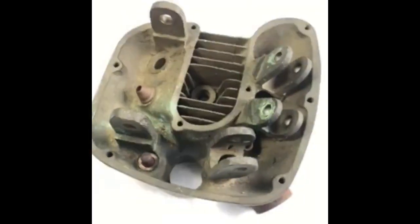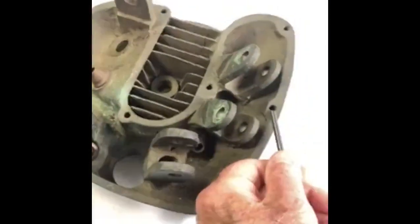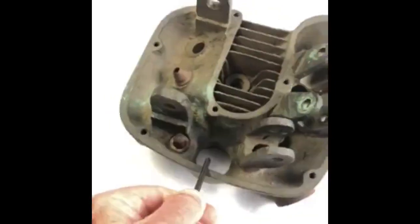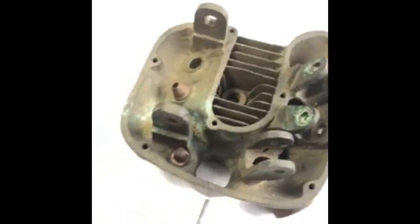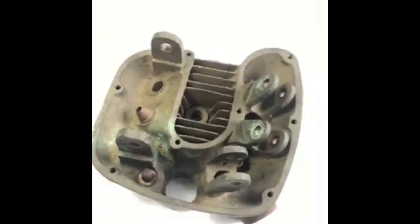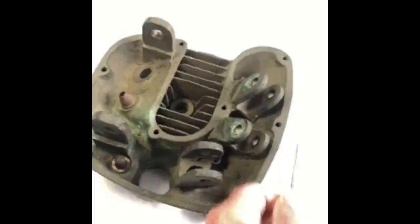So this is the 38 Ulster cylinder head, with 13 fins across the front, a rocker box fixing bolt in the centre at the front, which is the 8th bolt, 26 TPI pushrod tunnel tube thread and 1/2 inch short reach plug. The 37 variant is identical except that it doesn't have this fixing here for the rocker box.